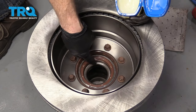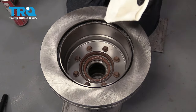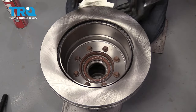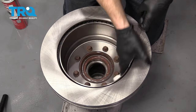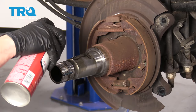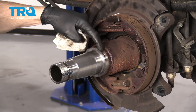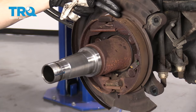I'm going to take a tiny bit of Vaseline and go right along this seal lip here. We're going to clean up our braking surfaces — you have your inner braking surface on the rotor and the outer on the other side. You don't want to forget where the emergency brake shoes ride. Make sure you have your collection receptacle down there, safety glasses of course. This area right here is very important to make sure it's clean, especially right up along where the seal is going to ride.